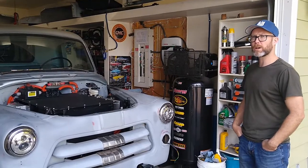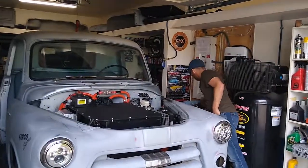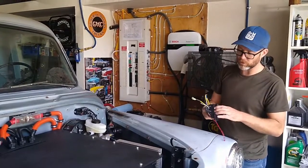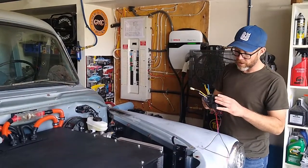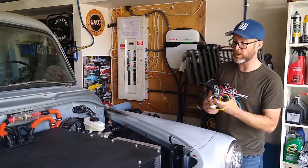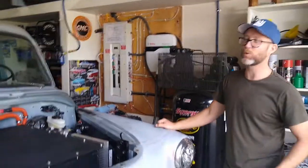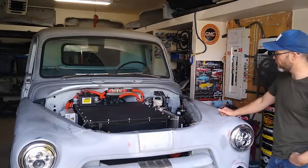We've had a couple of hiccups along the way, so there's some stuff we had to take out. The biggest hiccup was my 12-volt system — I had to completely redo it because, like a typical Scott, I was trying to save some pennies, so I bought the cheapest fuse block I could find, and it was total garbage — an Amazon special from China. I was getting 12-volt power constantly feeding back into the system and couldn't figure out why stuff wasn't switching off. The fuse block was garbage. I spent three times as much money because I had to do the same thing twice, but I've got a brand spanking new fuse block in there now and it solved my problem.